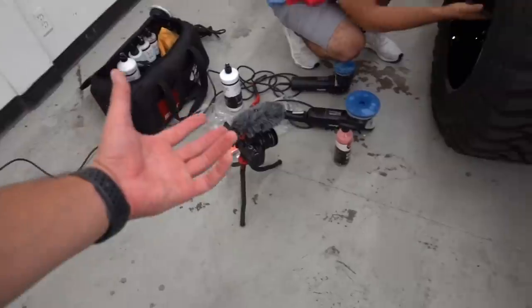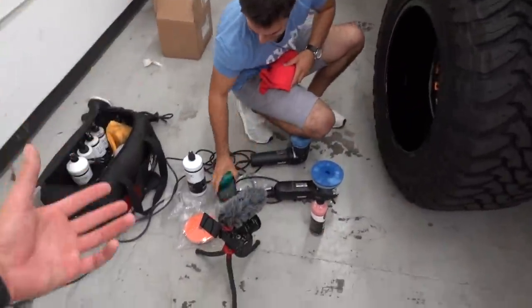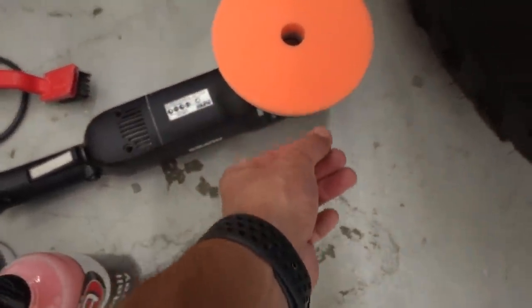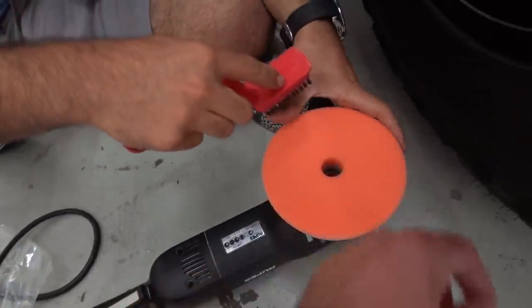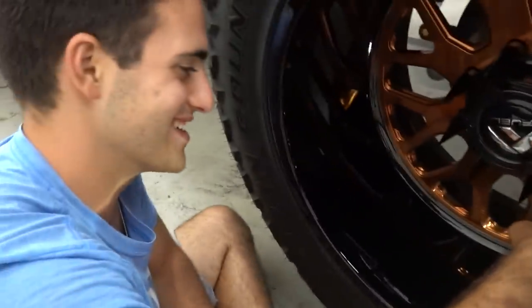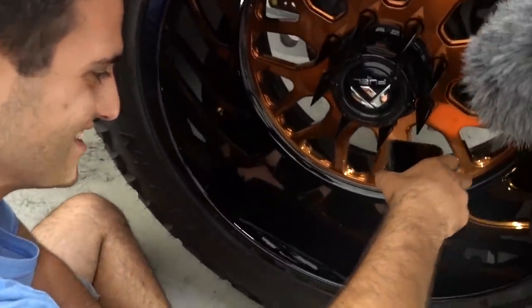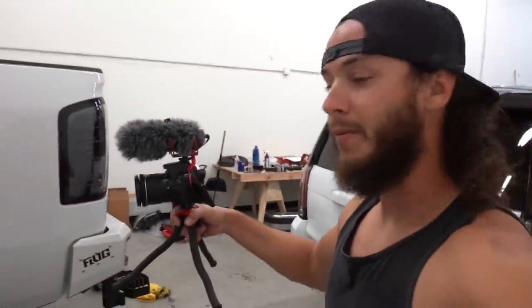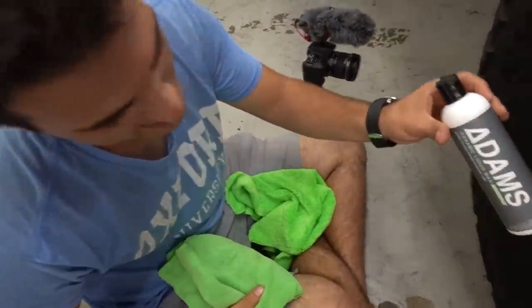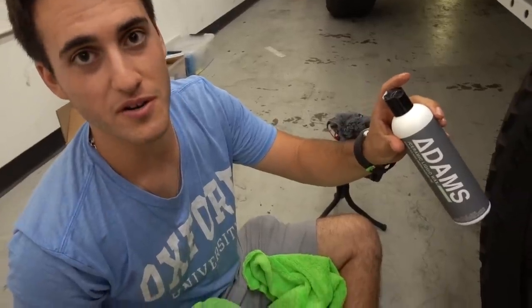See this part right here - that's a buffer trail from putting too much pressure, and that's why I have the orange pad because when it heats up it'll kind of stay in it. That's what a lot of people miss on their second step - you never want a buffer trail, it looks like a snail trail. Now that he hit the edge pretty aggressively to get the last bit of scratches out where the guy's shoe split off, he's going back with the big pad to blend everything in. All the cutting is done, the polishing is done.